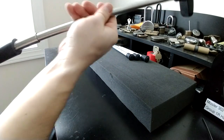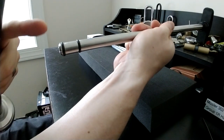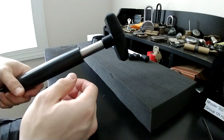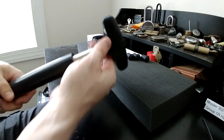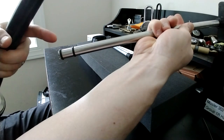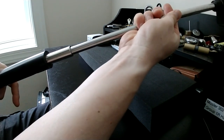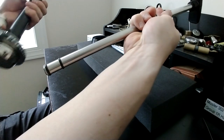That's your piston, which does come all the way out. First time you get it, just inspect the ends to make sure there's a bit of grease. I grease everything. You can wipe it all off and re-grease it with the included grease — you can use whatever grease you want. I use Molykote 111, which is a food-grade grease. It'll pick up black particles from coffee as well as a little bit of wearing of the seals, but mostly it's coffee fines that migrate up through there. It does blacken up but it's not a big deal. Just leave it until it goes dry and then re-grease as needed — you don't need to do that too often.